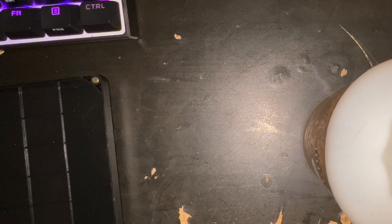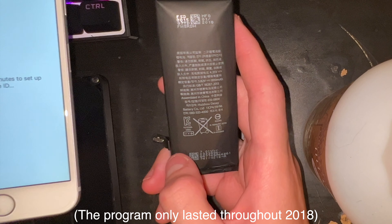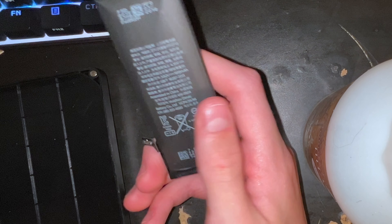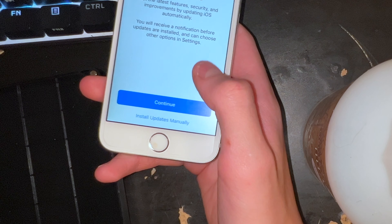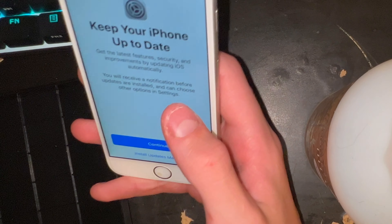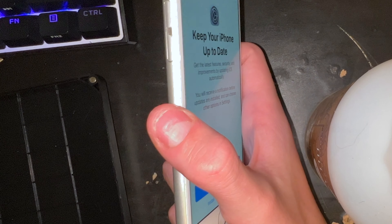One thing I noticed about the original battery was that it was actually replaced under the 2018 Apple battery replacement program and had 100% battery health. I wouldn't use that battery — not so much for fear of it blowing up, but more for fear of it destroying the display, and I want to keep this phone in good condition. The phone has a matte plastic screen protector and looks to be in great condition. The screen is popping out a bit, probably from the battery — it's not bulging, it's just that this high capacity battery from eBay isn't the best. Thanks for watching.